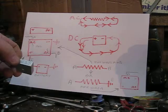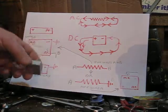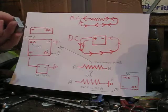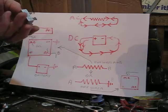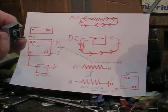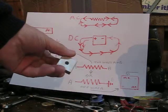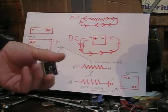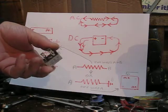A few people on the internet find it confusing when fitting solid-state rectifiers onto old bikes — no wonder, because they're not marked properly. When you get these old two-stroke bikes they also come with old selenium rectifiers, and they don't work. They didn't work in the first place and they're 50 years old now. You need one of these — a bridge rectifier. You can get them on eBay or electrical shops; I think it was two pounds fifty.